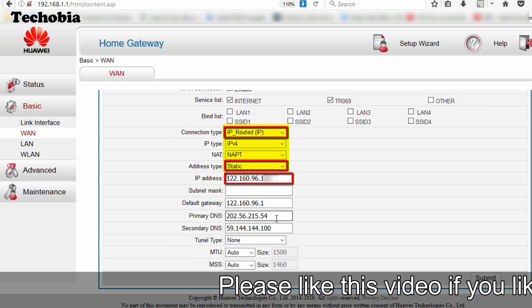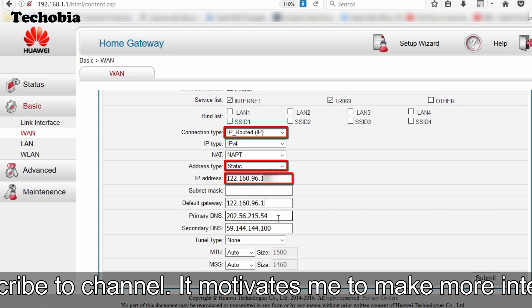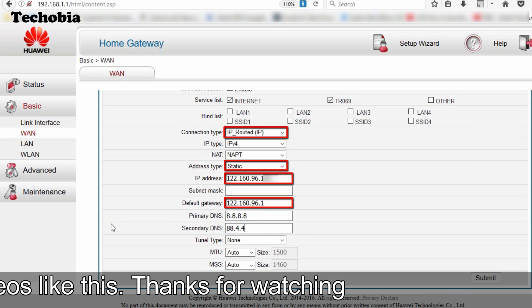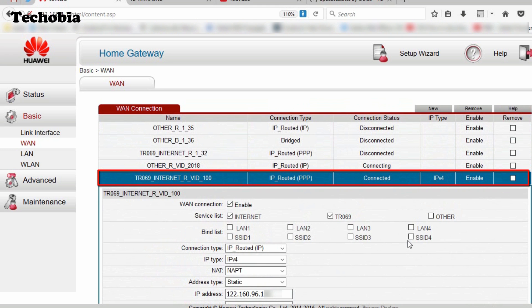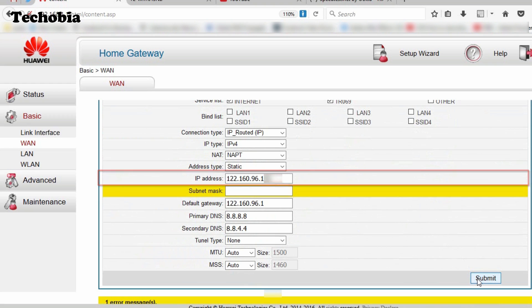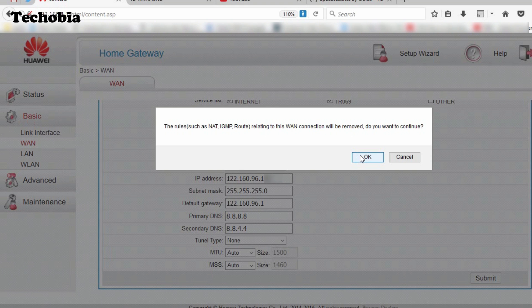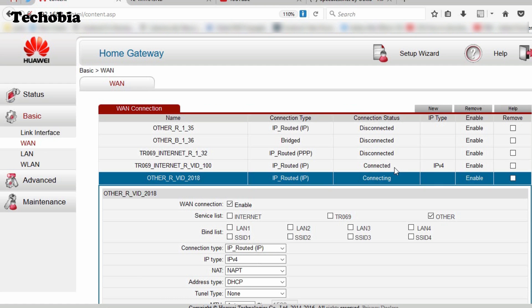For the primary and secondary DNS, you can use Google DNS, which I prefer, so I'm changing it to Google's DNS servers. Don't forget the subnet mask, which is simply 255.255.255.0. Click submit, accept the confirmation, and the settings are saved. Then restart your modem and wait at least three minutes for the DSL light to stabilize.